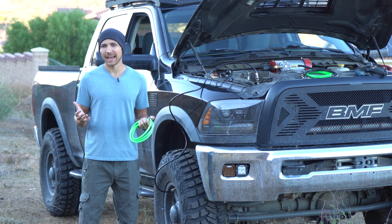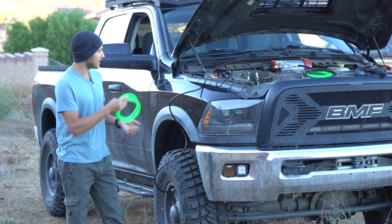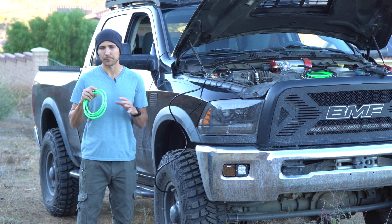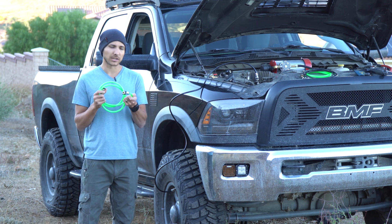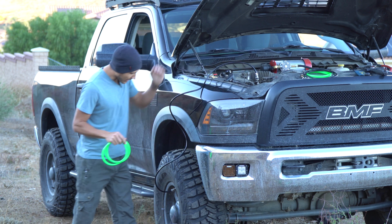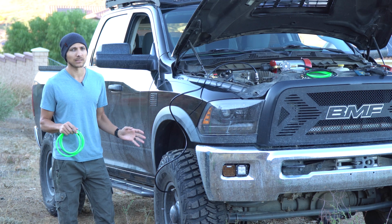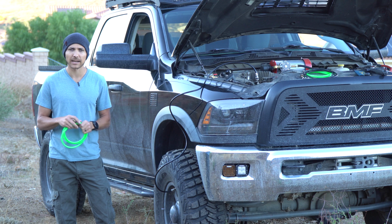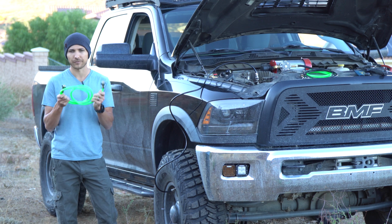The next issue that I have with the up-down air system is airing tires up. Now, it seems like a good idea having your main control panel here and hooking up all of your tires together. It gives even pressures. However, it's pretty slow. And again, that goes back to the Schrader valves. I think because you're now using a Schrader valve here and at the tire, your actual airflow going into the tire is probably pretty slow, and it's certainly slower than if you were just using a regular connection straight onto the tire instead of having two quick connections from the tire whips.